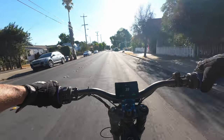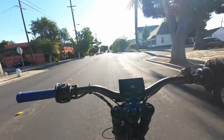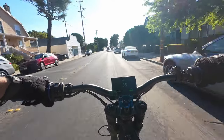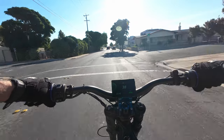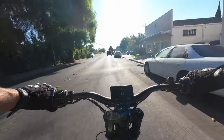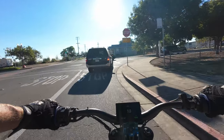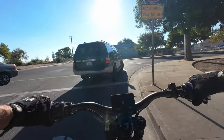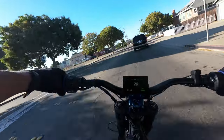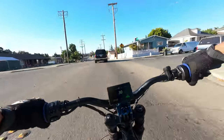This bike was actually kind of out of commission for a minute. If you're familiar with the e-ride pro, there was an issue where the battery cables can get melted into the battery itself — and that's what happened. E-ride said you can still ride when it happens, and if you recharge you just have to make sure the breaker is switched off. I didn't do much riding and just got this fixed last night, so this is the first time riding again. We'll also see if the new design with the more robust cables doesn't have the melting issue.